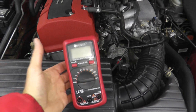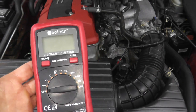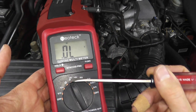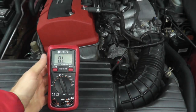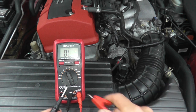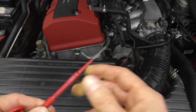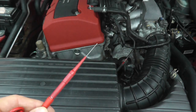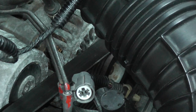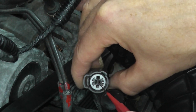A continuity test is very simple — you just need a digital multimeter. I'll have a link in the description box below for a specific one off Amazon, which is $23. You want the continuity setting, which looks like a Wi-Fi hotspot symbol. Plug in your leads that come with the meter. Continuity simply means two points make a connection. I'm also using a probe kit, which is really nice to have but not necessary — you can simply use a paper clip, though the probe kit makes the job easier. If using a paper clip, make sure it's thin enough so you don't damage the metal prongs inside the connector.